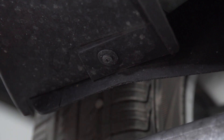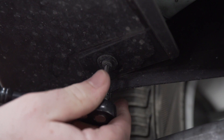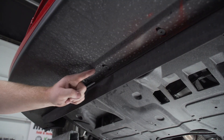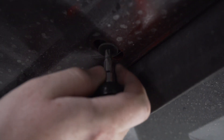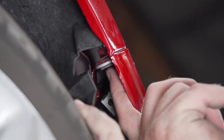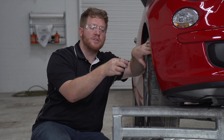On the bottom of our bumper fascia, right on the end by the wheel well, we have one screw that we're going to remove using a Phillips bit or Phillips screwdriver, and then we'll repeat that on the driver side. Now in the middle of our front bumper fascia there are three screws that we'll be removing using a T30 torque screw bit. Now that we have those three screws out, on our wheel well we're going to pull back on that liner on the inside — it's going to expose a gray screw right up here on the top — and we're going to remove that using a T30 torque screw bit.